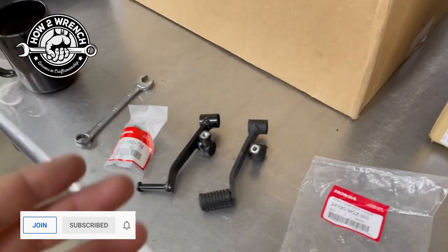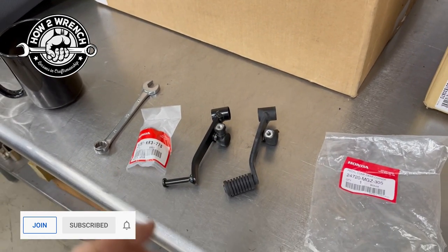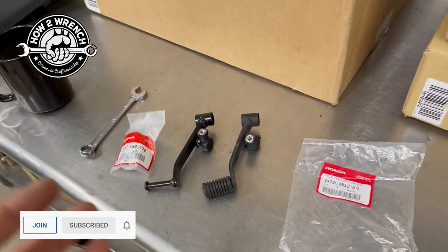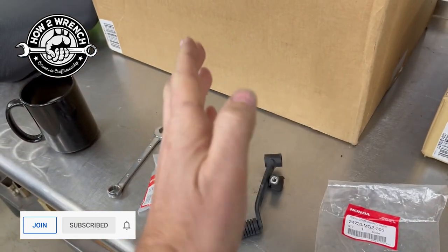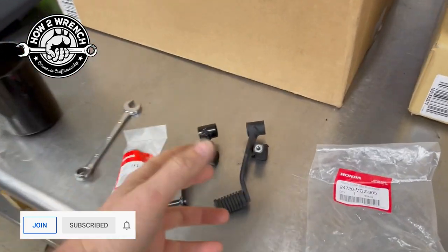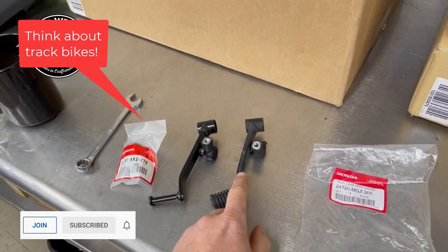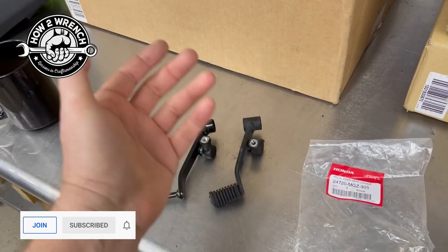It's really common, and I'd be a liar to say that I haven't bent a lot of levers back — 'oh, it's not that bad.' This is a great example because it's pretty thick. What I want you to think about is when you bend metal back and forth and back and forth, it obviously weakens it. The problem with buying wrecked bikes and fixing bikes is you may not know how many times it's been bent or how weak it might be. Next thing you know, it's falling off, going through a tire, going through someone's windshield, and so on.